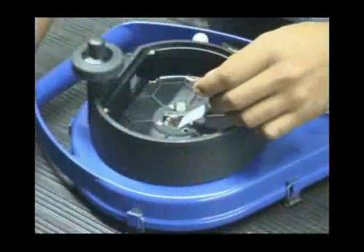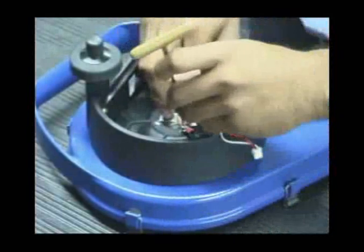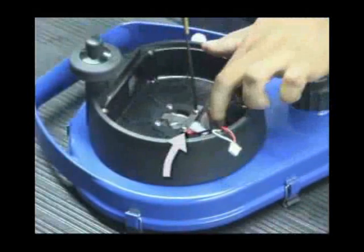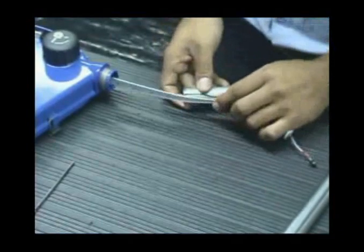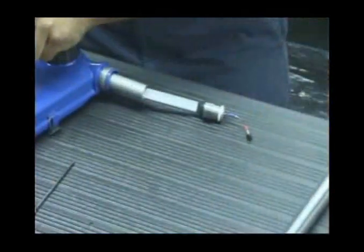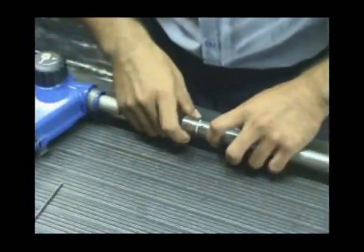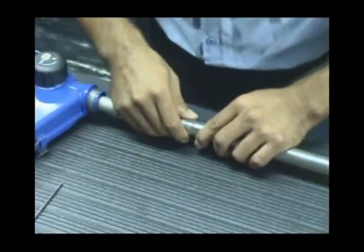The metal tape retainer must be replaced in conjunction with the ground wire, as these are part of the internal grounding integrity. When replacing the protective sleeve, note how the ring is toward the body. At this point, replace the electric wire plug and make certain that you do not deform the O-ring. When the two pieces are firmly seated, align the holes and replace the set screw.